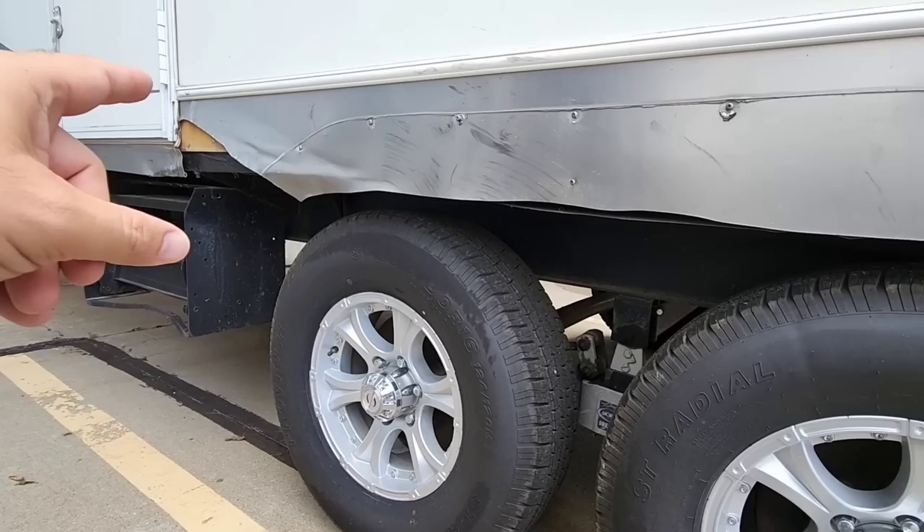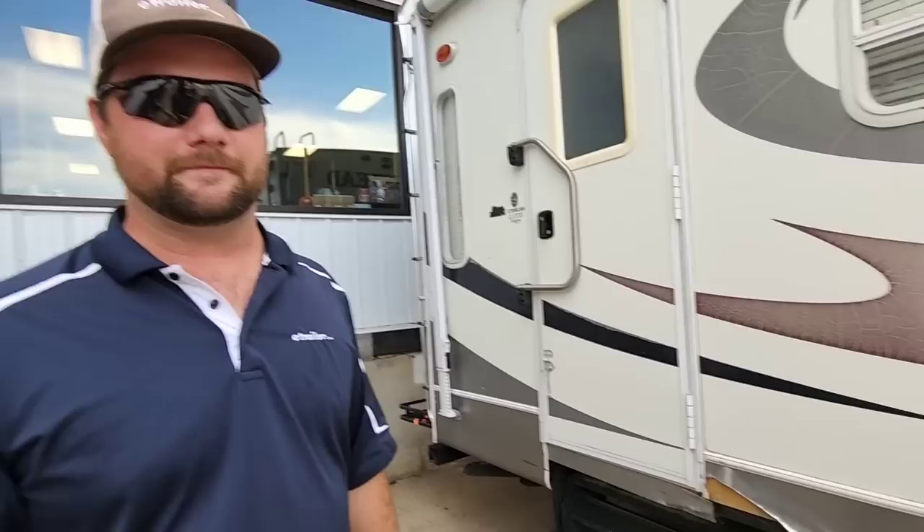Did you have a tire blowout at some point? I did — and we actually made a video about it. I bought this camper cheap, and having worked at etrailer, I made the mistake of assuming the tires were fine because the seller said they were brand new. It turns out the camper's max GVWR is 12,000 pounds, and each of those tires were only rated at 2,000 pounds. So I was way overloaded and drove around for two summers like that. Then, headed out for a trip, luckily just in the town next door to our headquarters, I had a blowout. I had to upgrade to tires definitely rated to tow this amount of weight.